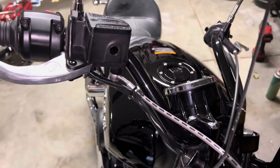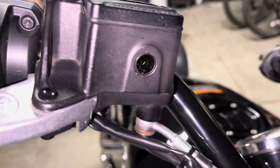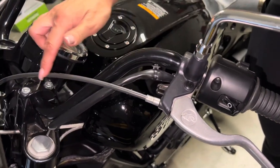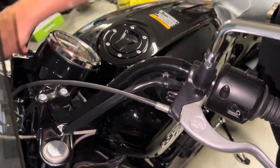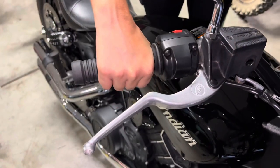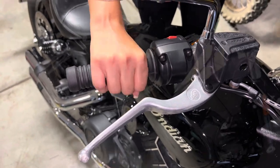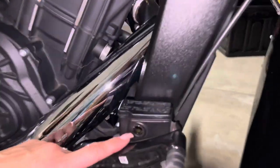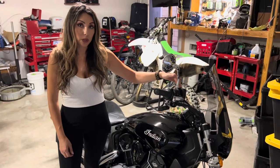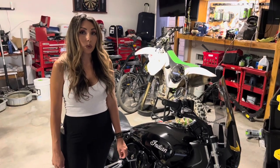Check your brake lines, making sure there's no damage and checking the fluid level. Check the clutch cable — you can actually inspect the clutch cable and brake line at the same time. Turn the throttle to make sure it's nice and smooth with nothing obstructing it. Level the bike and check the rear brake fluid. Note that you should never need to add brake fluid — if the window shows minimum, that indicates your brake pads are worn and it's time to change them.